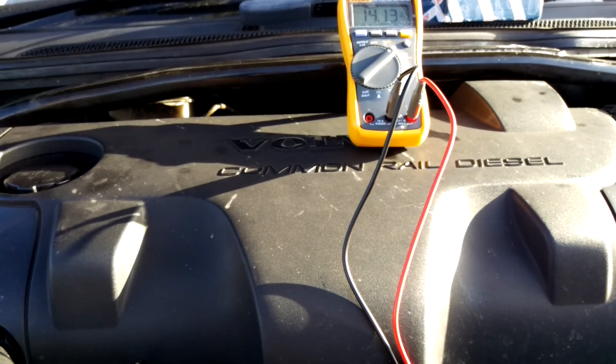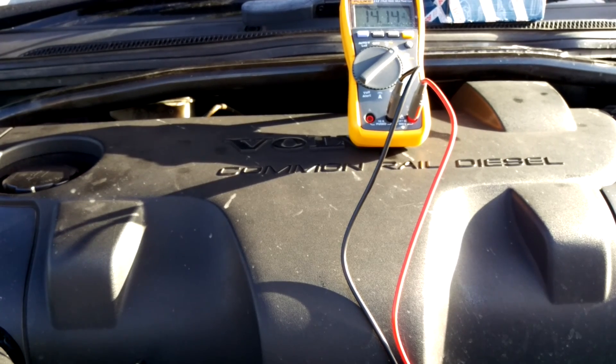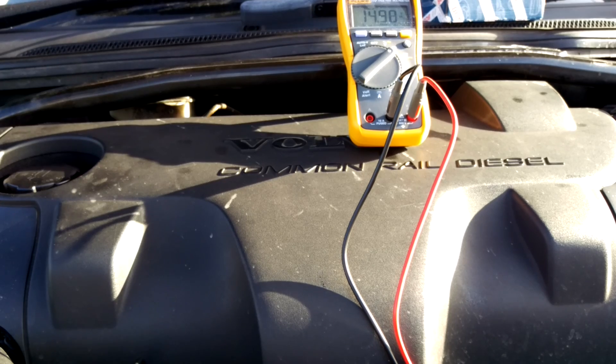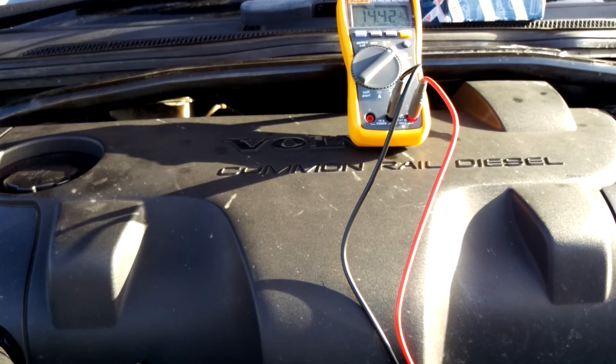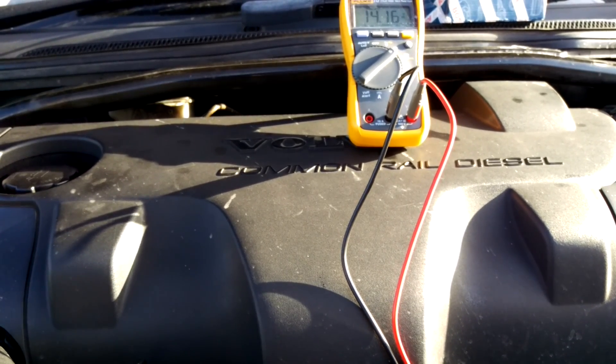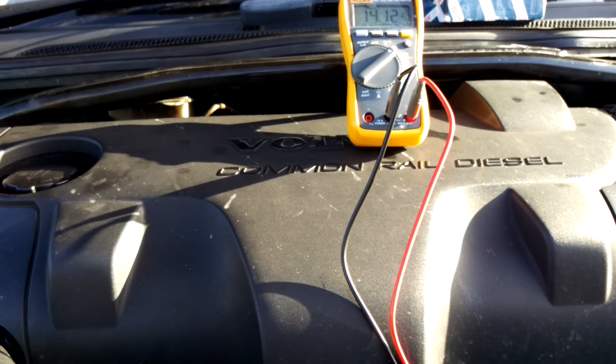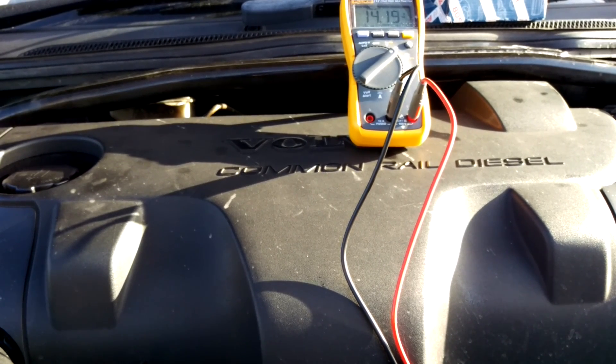That's showing me again that it's reacting quite nicely and regulating the voltage. When the electrical load increases on the car it reacts and allows more voltage to be produced by the alternator. With all the electrical load on, I'll do that rev test again just to make sure the voltage doesn't go spiraling out of control. No major problems — it certainly didn't go anywhere close to going over 15 volts. So all those tests on the voltage regulator say that everything is actually alright.